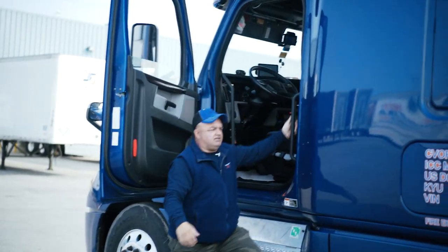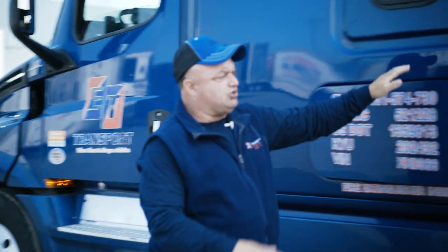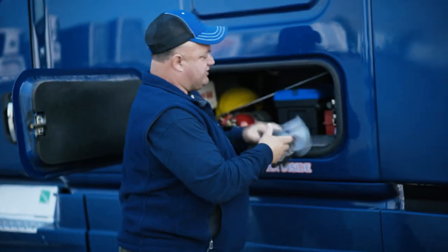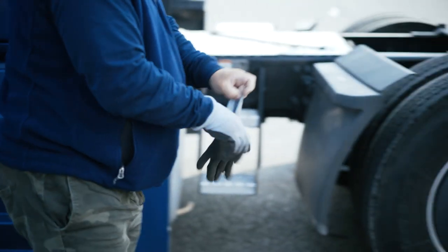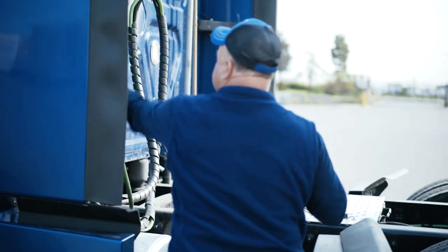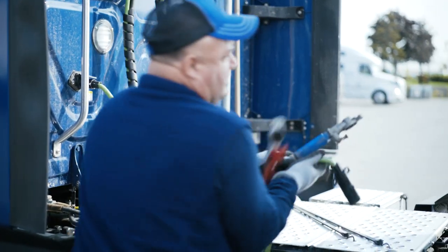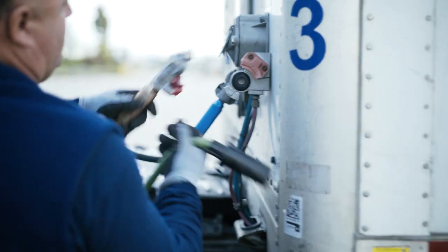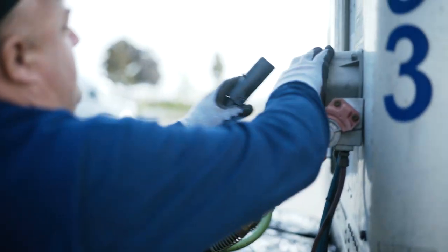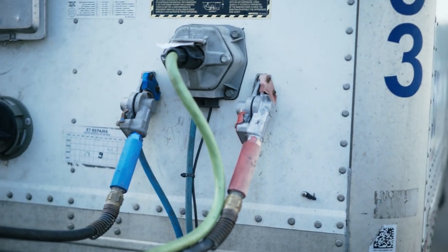As you can see, I always try to bump just to your bumperette. Grab your gloves from inside your compartment. I know it looks like a long ways but the lines will stretch. Grab your lines — hook your blue to your blue, the red one to your red. Make sure that stays there, which it will. Then you would crack back and jump back into your truck. I'm going to drop my air a little bit so I don't drop all the grease off my fifth wheel, and then I'll back under till I hear a click, then give a tug test.